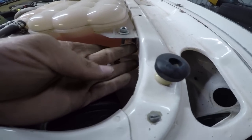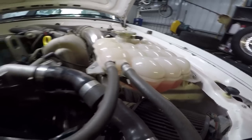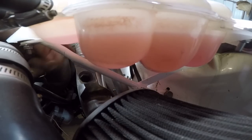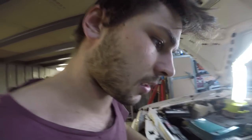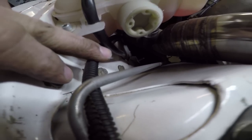I've got some little tabs under here which bolt up to the body, and then I made this pretty wacky looking bracket out of just 10mm rod, and then just made up a heap of tabs. One picks up the air intake, which you can see there. This is just tabs, your friend, with shit like this mounting it. And then the overflow just drains, still in the same spot, just runs out into the wheel arch. So yeah, that's the cooling system.